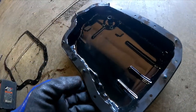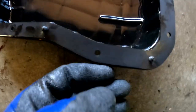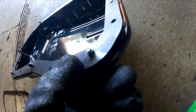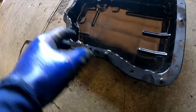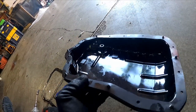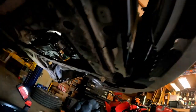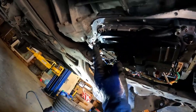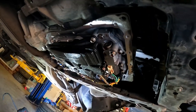For the new gasket — it's rubber, so it's kind of hard to line up. The holes on the gasket are a little bit smaller than the pan. I pre-insert the bolts so it's easier to catch the gasket and it doesn't slide around. Pin every corner so the gasket doesn't run away from you. The filter is bolted up with one bolt there and one bolt there.